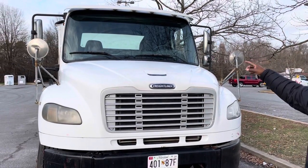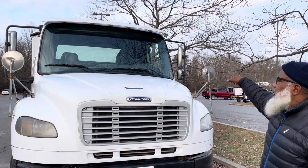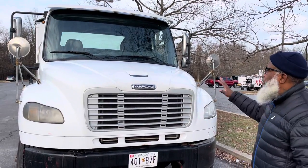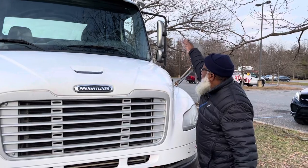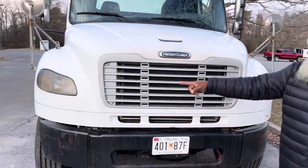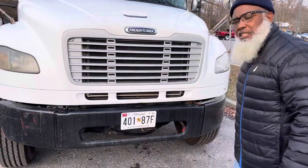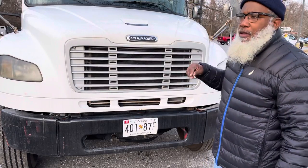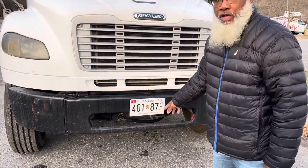My windshield is not cracked, not broken, and secure — no obstructions, no illegal stickers. The seal around the windshield is not cracked, not broken, and secure — not dry, rotted, or frayed. The windshield wipers are not cracked, not broken, and secure — flush to the windshield. The hood mirror, fender mirror, spot mirror, and flat mirror are not cracked, not broken, and secure — no illegal welds, no loose or missing parts. My headlights are not cracked, not broken, and secure — no condensation, clean and clear. My suspension is balanced; if it weren't, I would place my vehicle out of service. My tags on my truck and trailer are secured with no outdated stickers. No leaks or puddles or broken glass underneath the vehicle — if I had that, I would place my vehicle out of service.